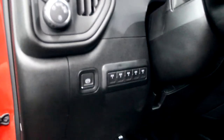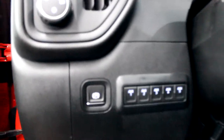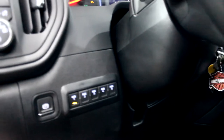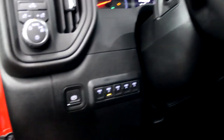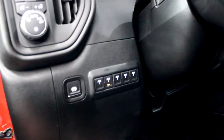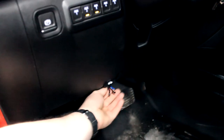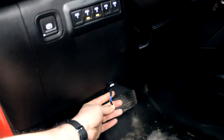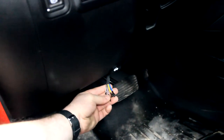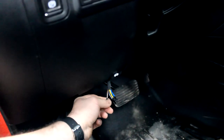So we know we have switches 1 through 5, and the real question has been where is number 5. We know number 1 was the blue wire, number 2 is one of the smaller ones — I think it was the brown — and gray might have been number 3. Don't get these wires mixed up with the wires for adding a brake controller. It's these 4 wires here: the blue, yellow, gray with a dark black tracer, and brown with a white tracer.